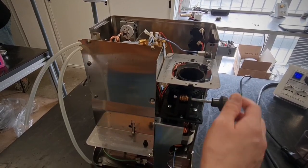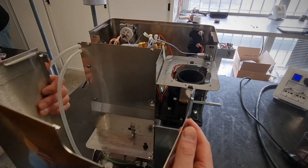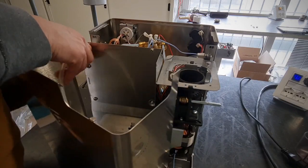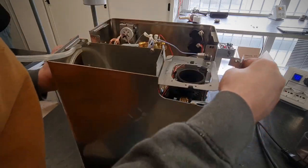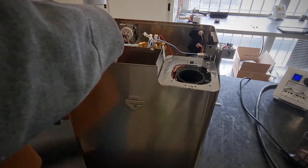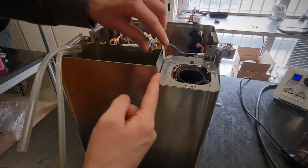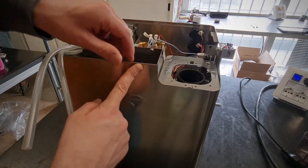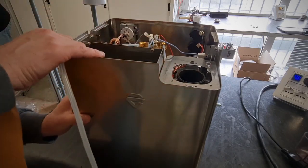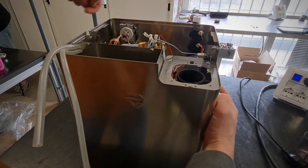Remove the hopper — with the hopper installed it's not possible to assemble the machine properly, and we can damage it, so it's better to install the hopper last. Remove the power cord and the handle. Remove the tubes here. As we can see, there is a clip here — I have to install it. Now I have to put in the two screws here.